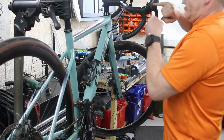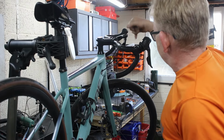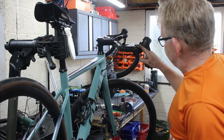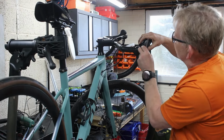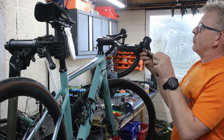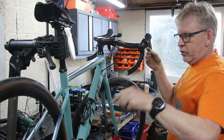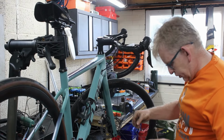what normally happens is, because it has to go through quite a tight bend up there, quite a tight bend to get round there and there, so it's coming along here, comes through there, it goes a really tight bend across, and then round a spool. So that is really tight. It tends to go just about there on the spool, and you always get a thing off. What happens is these get jammed. So weirdly, that should have just popped out nicely, but it didn't. But yeah, it's all off up here as well. So I suspect it's not been that crisp, because that's been going. Obviously, because it's not got as much coating on, it means the wire's thinner, which means the wire is then taking a shorter route through, which means it's slacker, which means the derailleur's moved across, and it's 0.05 of a millimetre, which is actually quite a lot.